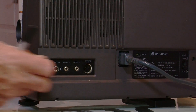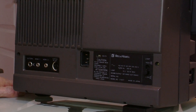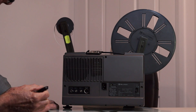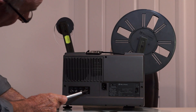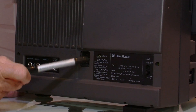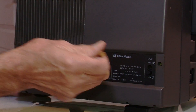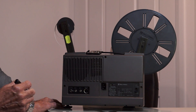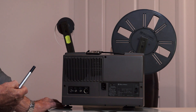Around the back — I'll have to unplug it to show you this — we have a quarter-inch jack which will feed a speaker, and that is a direct output from a 10-watt amp within the machine. So you can have an additional speaker put behind the screen to give a more realistic sound effect. You can monitor each track here — monitor one, monitor two — so you can put headphones on these. And there's a thing here called 'sortie play' and I'm not sure what that really means; if anybody knows, they could let me know in the comments below. Traditional kettle-type plug here. This switch is high and low for the lamp — you can have the lamp on full or low, a bit like eco mode on modern projectors. I've always run it on low because the difference is minimal really, so it may preserve the lamp a little bit better.